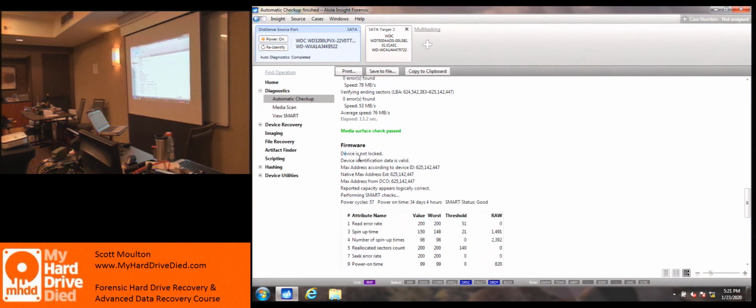And then it double checked to see if you could talk to data. There's a security mode, and you can see the security mode in the firmware. If somebody added a password, then when you try to copy a sector, it will give you an error. But everything about the drive seems fine. So when you get the error, you can double check what's called the passport information, and it will tell you, do I need to clear a password, or do I have a password on the drive?